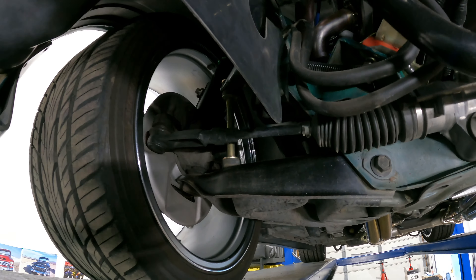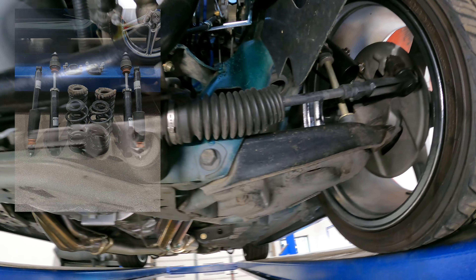Both sides are the same. Now this situation isn't as bad as it used to be — now that I've got my car on this air ride system and I'm running a little lower, these two do run more parallel than they used to when I just had a set of Eibach progressive lowering springs. Typically where you notice bump steer the most in these fox bodies is when you're lowered an inch and a half or two inches — these two items will be nowhere near parallel. When you hit uneven roads, ruts in the highway, or a heavy bump, and these two items move at the same time but on different angles, your steering wheel goes all over the place. It's something I've dealt with for many years, but it's not ideal and you can fix it — with one of these.